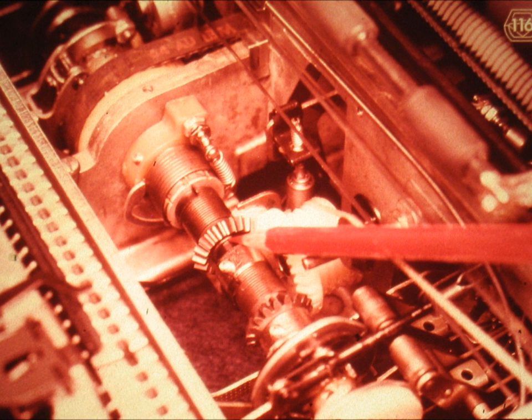Slide number 116. Regardless of the level of the torque limiter of our machine, we need to be able to move the operational shaft sufficiently to the right in order to remove the indicated C-clip mounted on the operational shaft to the right of the carrier return pinion gear. This C-clip is a very important part of the operational shaft. It is the only part on the shaft which is not adjustable sideways unless we also move the operational shaft sideways. All other parts can be moved left or right at will, because they are only fastened by set screws. The C-clip, however, fits into a groove on the operational shaft, and that is the only groove there is for it.